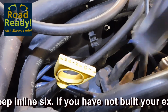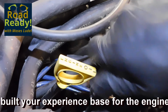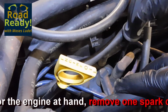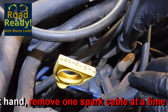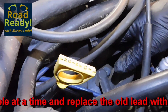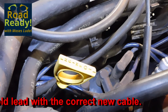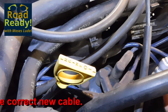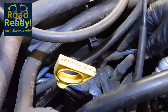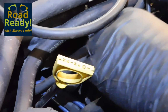It's important to know which terminal in the distributor cap goes to the number one cylinder. Here, I'm removing the distributor cap by loosening the two screws that retain the cap to the distributor housing. On most distributors, this Jeep housing, as an example, there is a locating lug on the distributor cap for making sure the cap only goes on in one position. There is a short, high-tension coil wire that looks like part of the cable set, but actually goes from the center of the distributor cap to the coil. That needs to be removed as well.